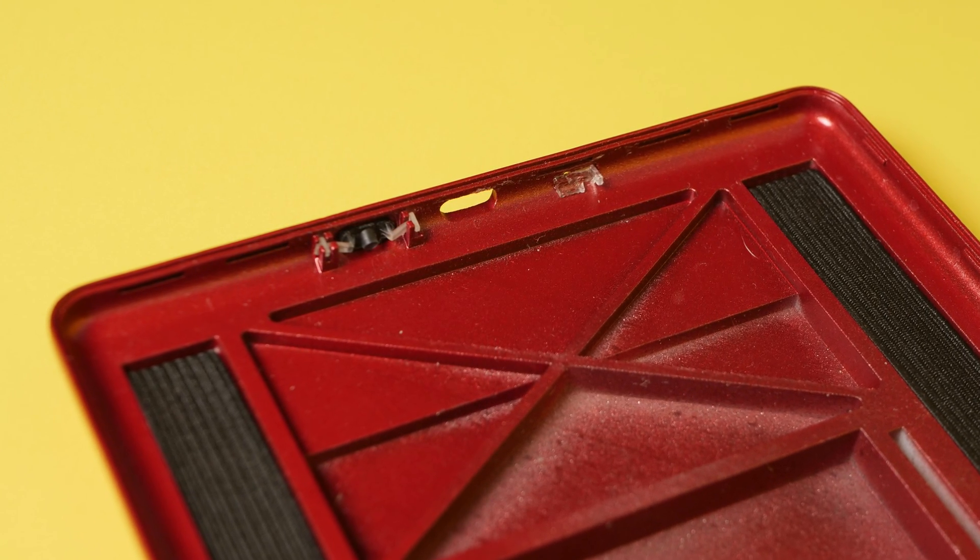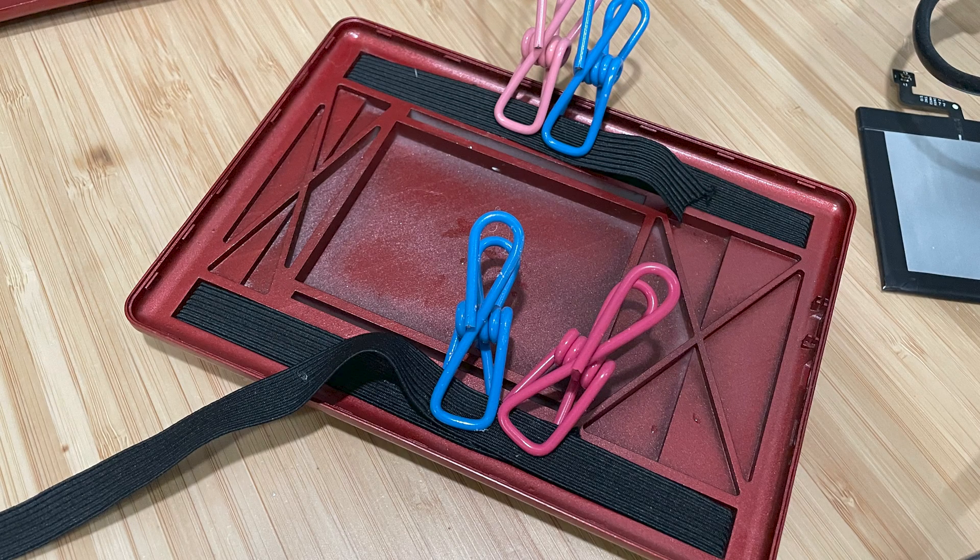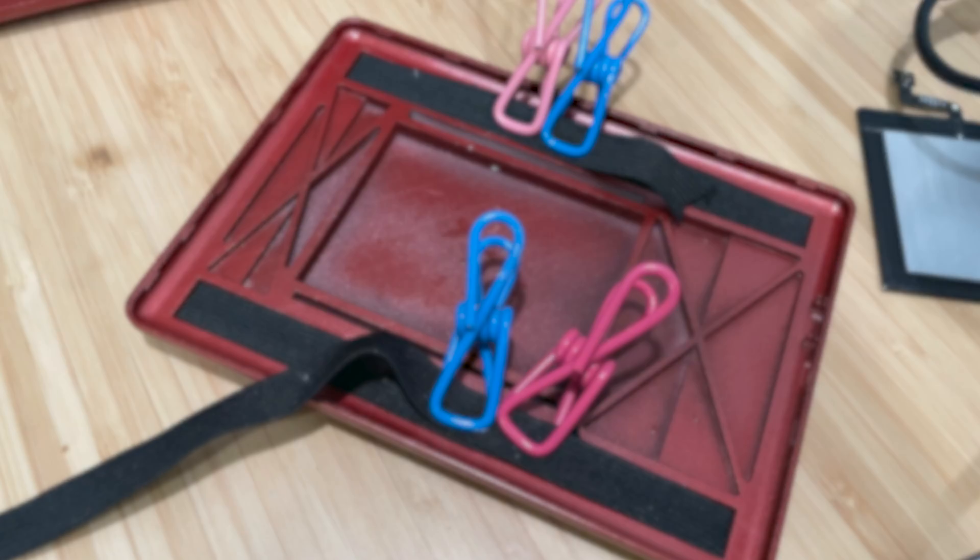Then carefully solder the connector, resistor, and battery onto the flex cable. Pay special attention to the connector — orientation matters, so check that it mates with the connector on the Kindle's mainboard. The enclosure comes apart with force; I'll put a link in the description to a video that walks you through how to do that and how to remove the battery. A few drops of Goof Off will help loosen the adhesive holding the battery down, which will make it much easier to remove. With all that done, connect the new battery and turn on the Kindle to make sure it works. Assuming it does, put the button and LED light tube into the 3D printed enclosure. Use a dab of glue to hold the light tube in place, then pull the straps through nice and taut and use some E6000 glue to form a continuous loop. Some spring clip things will help keep them secure until the glue dries. Wait 24 hours, then snap the new enclosure into place and you're done.